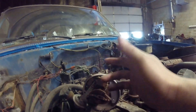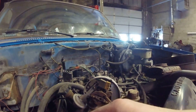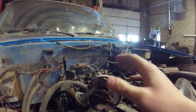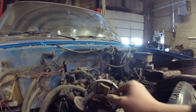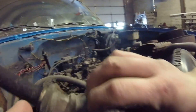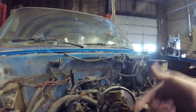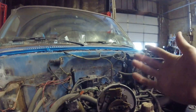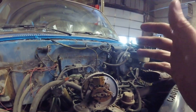But we can do something different. So we have a lot of old Chevy parts laying around. We took a distributor out of a 1979 van, and that had, instead of all of this, down to around the shaft right here. So since it ran off the shaft, it ran off of itself, which meant it didn't need that computer box. So once I put that new distributor in there, it worked.